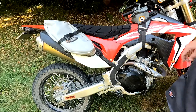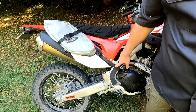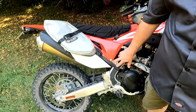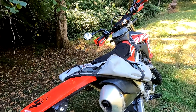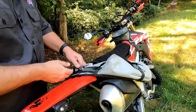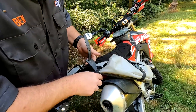If it's not touching the exhaust, you're probably okay. What I'm going to do is add our Giant Loop mounts — they're just not here yet. I'll put a Giant Loop mount right here so I can quickly and easily take this on and off without having to run the strap all the way around the frame. I'm always moving these bags between bikes, so I like to have those quick-release mounts. This bike doesn't have passenger pegs, but you don't need them for the Mojave. On the back, it's just hooked on the fender with fender hooks — there's no rack on this bike.